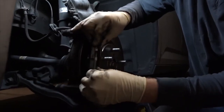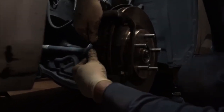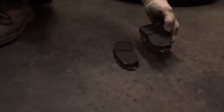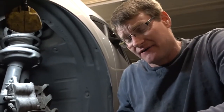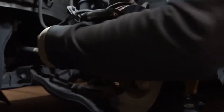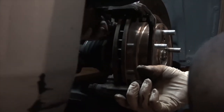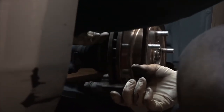Now you should be able to just pull these brake pads straight out. To get the rotor off, we actually need to remove the caliper bracket itself, and it's held on by some 19mm bolts inside — there are two of them. Be prepared to put a little force to them. Break them both loose so you're not having to spin the caliper bracket while trying to break another one loose. Once you've broke them loose, they usually thread out really nice and smooth.